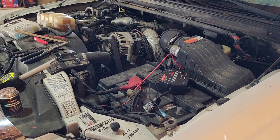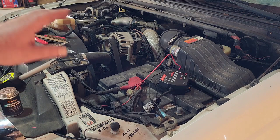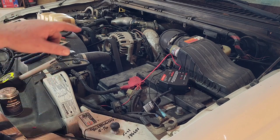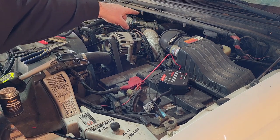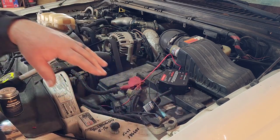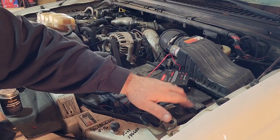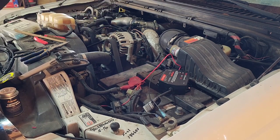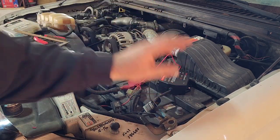My wife has a 2007 Escalade ESV, and the whole thing shut down, dash wouldn't work. I mean, everything quit. And it turns out there was a ground strap that ran from the motor to the firewall that was slightly corroded, and the battery terminal ground was slightly corroded. So it lost ground, the computer stopped talking to itself. Cleaned up the ground post on her batteries, added an auxiliary ground strap, same spot, worked like brand new. So, however you use your dielectric grease, just make sure you clean the post.